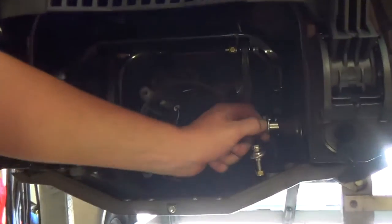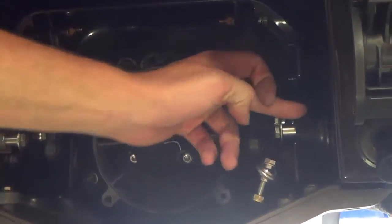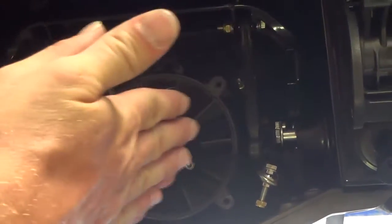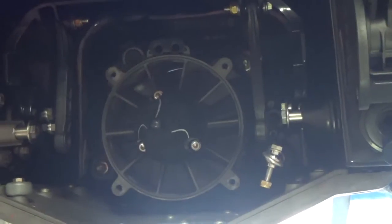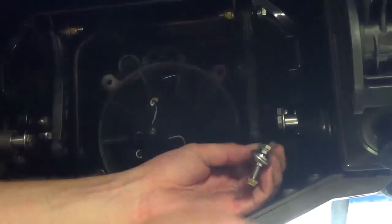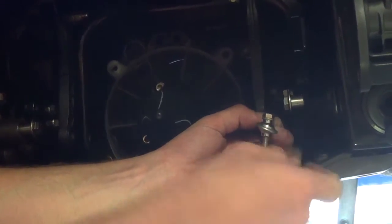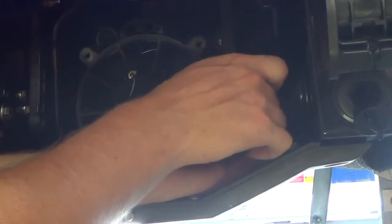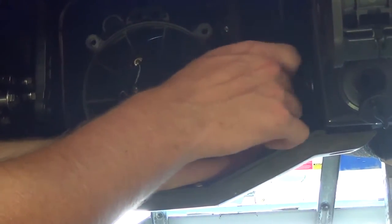And as I mentioned before, be sure to put these bolts back in their holes, especially on this side, because if you don't, this bracket here, it doesn't get put back together, and you can take on water right here pretty considerably, and you could conceivably sink your ski. Also, another thing you're going to do is take this rod end bearing off, because we have an extension that goes in between here, so that you still have steering on your Jetovator. So you just take that off, and it exposes the steering cable.